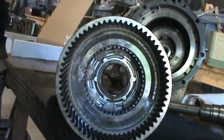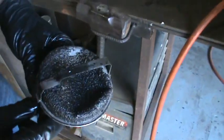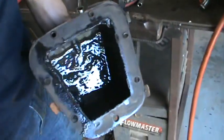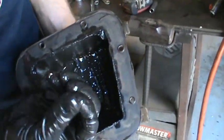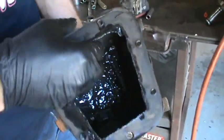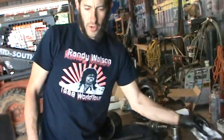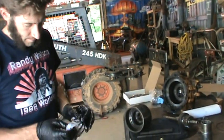And that's indicative of this pan. Look here — this is the filter that I pulled out of this pan. Look at that. Good stuff, it looks great, doesn't it? And here is the inside. We can pull it out and it's just grit and grime. And what that grit and grime is is transmission discs — that's your forward transmission discs. Time does it, water does it, just abuse does it.